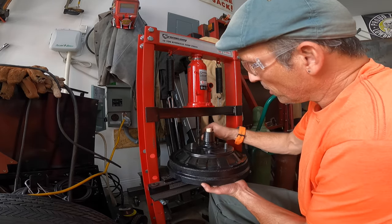I'm going to go remove the hubs from the other rear drum and the two front drums, and I won't show that unless I come across some kind of important issue — so time jump now to everything being disassembled. Got everything separated. The second rear hub came off pretty much just like the first, no problems. For the fronts, only one small issue: when pressing out the studs I had to modify my tool by cutting a groove in it, because the front hubs have a web coming down off the center part. I needed that groove to make it sit flat and support it better — and then that was it.